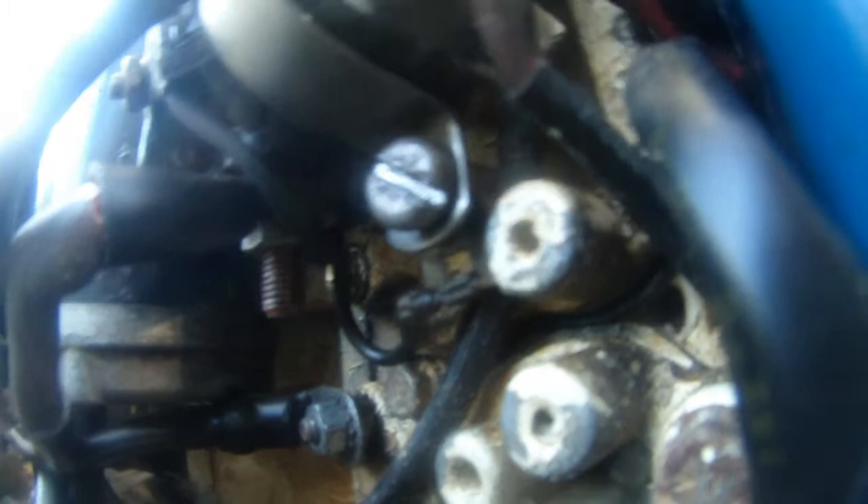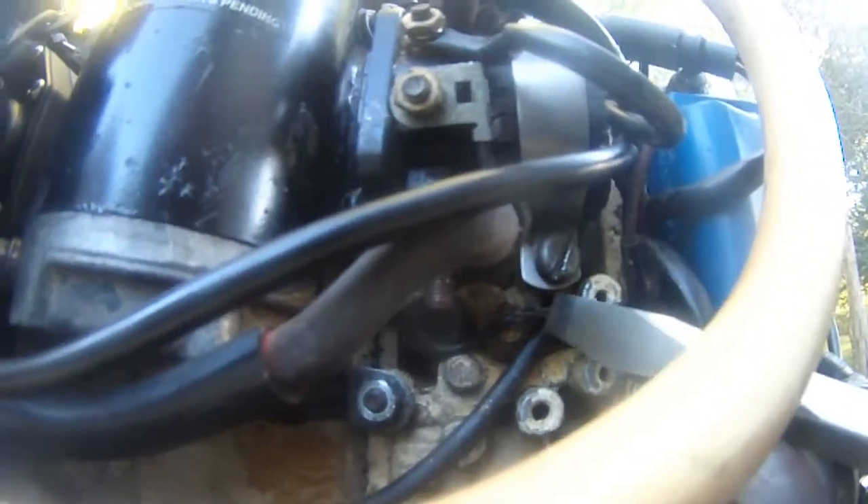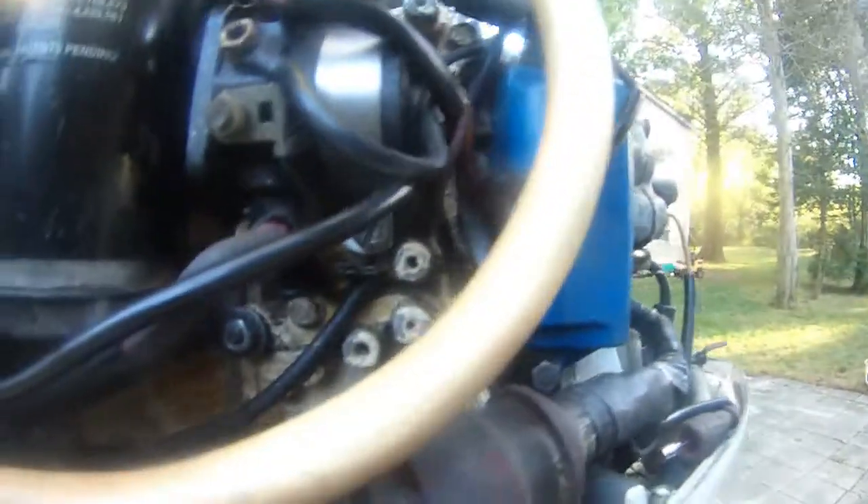I don't know how I was able to start the motor. I'm going to tighten this down. You can kind of see this thing here is not tightened — that's why the starting solenoid got some problem. So I'm going to unscrew this and then tighten this.